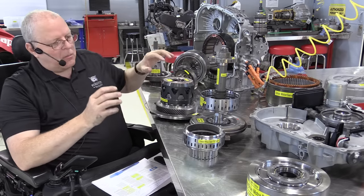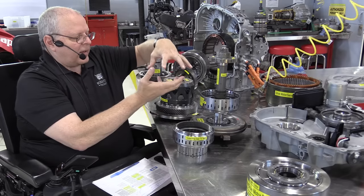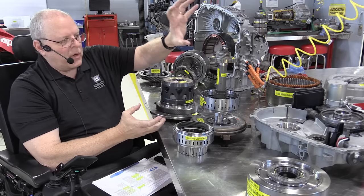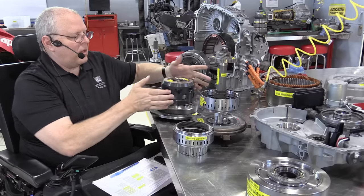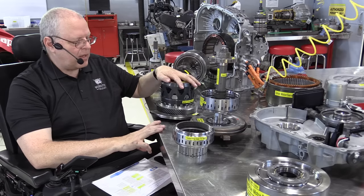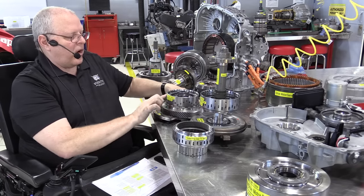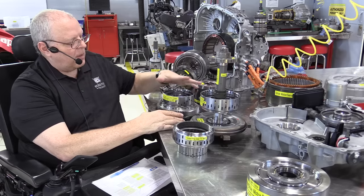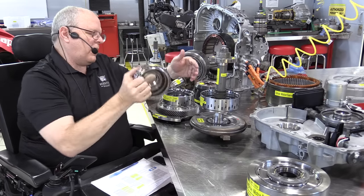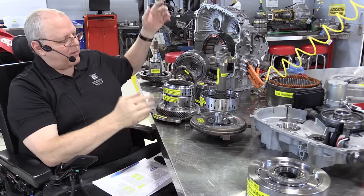And in that case, motor A would drive the ring gear, motor B would drive the sun gear. We would have direct drive, a direct connection here on our planetary gear set. So we could toggle between motor B, motor A, and still propel the vehicle in the same direction. The only clutch pack that has to be released to eliminate any trouble in all of that is this brake here, the variable low 1-2 reverse clutch, which is really a brake, which is intended to stop the ring gear from rotating so that we have some resistive force when motor B is driving the vehicle down the road.